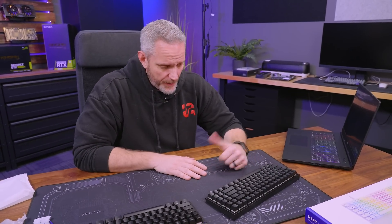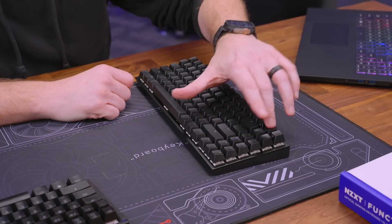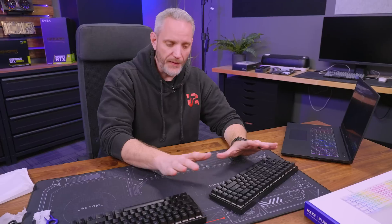When it comes to keyboard size, you'll find 10-keyless which is about 80% the width of a normal keyboard, all the way down to 65% where keys are even closer together and might omit insert, page buttons, or even arrow keys. I can't type on those — I've got too big of fingers. This is the second optical keyboard I've ever typed on. They're actually very nice, especially because you can adjust the actuation point, which you can't do with mechanical. With mechanical, where it is is where it is. I personally would probably leave it at one millimeter — I tend to sometimes not press the key all the way down, so a sooner actuation would be really nice.